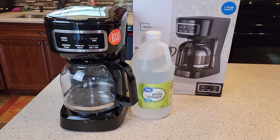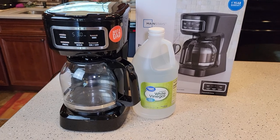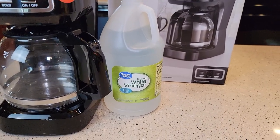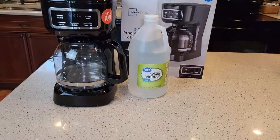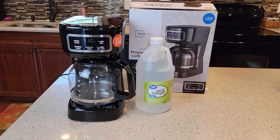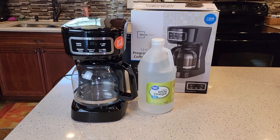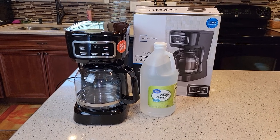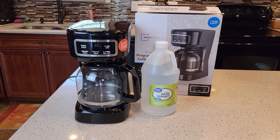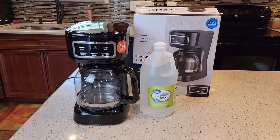You need to keep up on your regular scheduled maintenance, and that is called descaling. Is your coffee not tasting as good as it used to? Is it not as hot? Is your coffee maker starting to get really loud? These are all signs that it's time to descale. You should descale your coffee maker every six months. If you've got hard water, you might want to do it a little more often, but at least every six months.